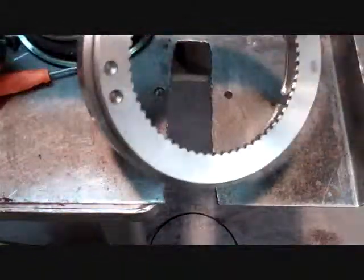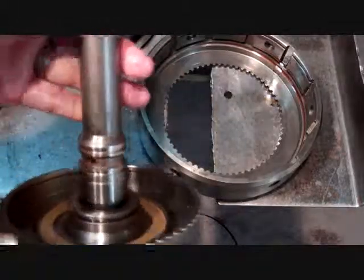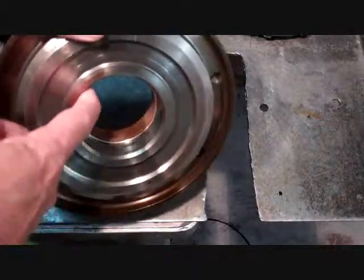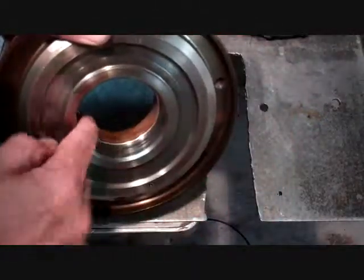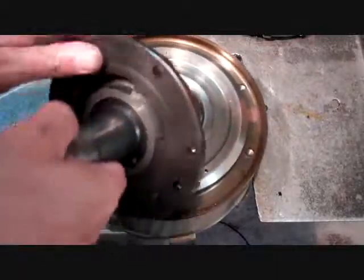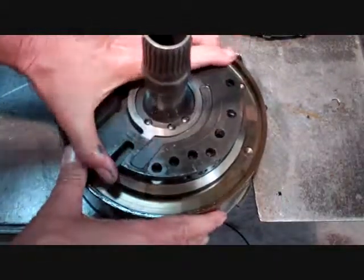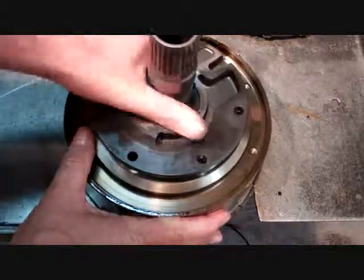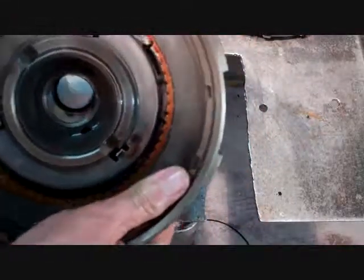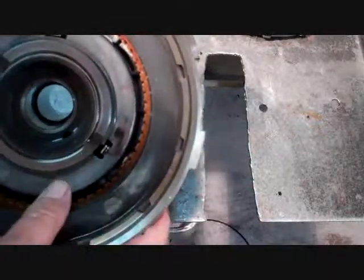Pretty simple drum to build, but keep all your parts together so you don't get confused. Inside the drum, we want to feel where the stator goes into the bushing — that's this part of the pump — so we can set it in there and feel side to side to see if we have movement. You can see when I turn it over where this stator goes into this bushing. This bushing's tight, it's in good shape. If we had movement in here, we would want to replace this bushing.